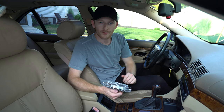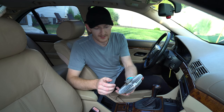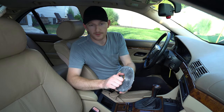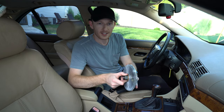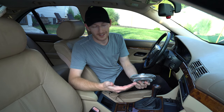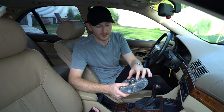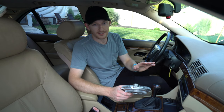After 248,000 miles like I have on this E39, the fluid can fail in one of two ways. Either it stops in the fully locked position, so you'll have the fan working extra hard and engaged all the time — that's probably the better way to fail because you still have cooling capability. The other way is the jelly-type fluid stops working altogether, and that's the worst way it can fail because it usually results in the car overheating.